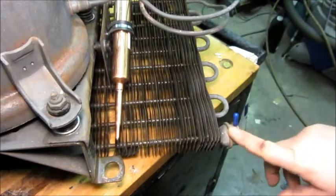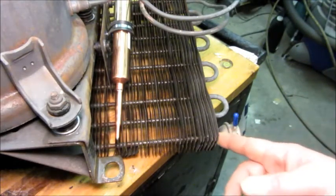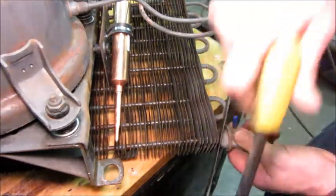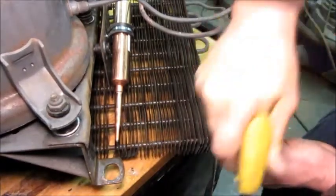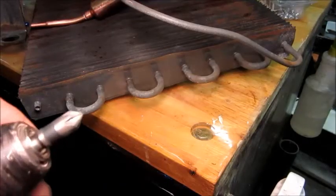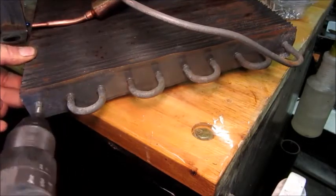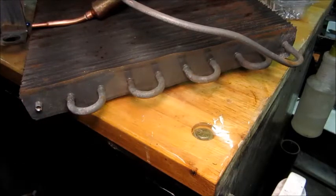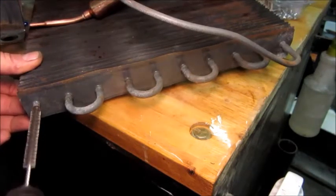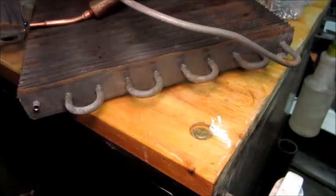The first thing I want to do is get this off of there — I'll go ahead and cut it off and get it out of the way. I'll prepare this end to have a three-sixteenths copper tube soldered inside it to go around to the new dryer. I'm going to take a countersink tool to make sure it's got a nice end on it, then come in with a tube brush to make sure it's nice and clean on the inside where it'll take solder. Now the new dryer is in place — the liquid line coming out of the condenser goes in there, and that's where the cap tube will go. Everything is cleaned up.